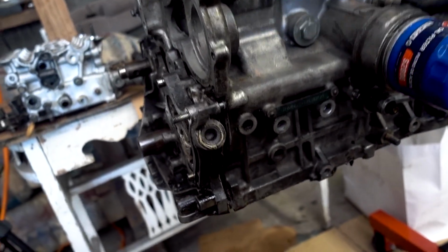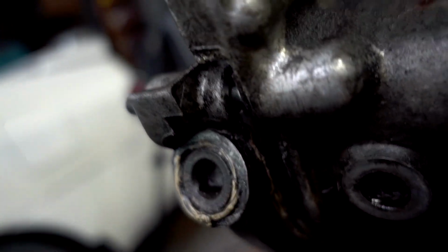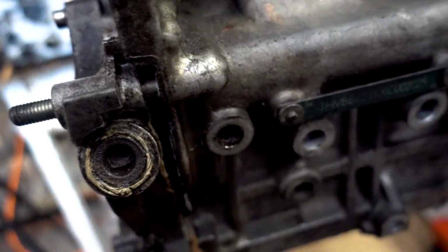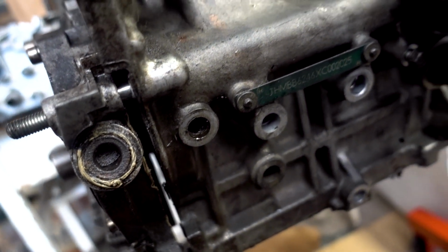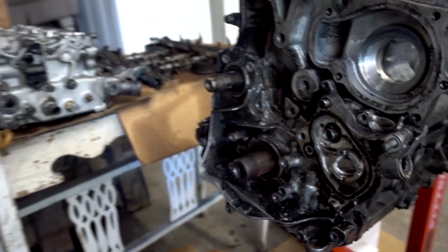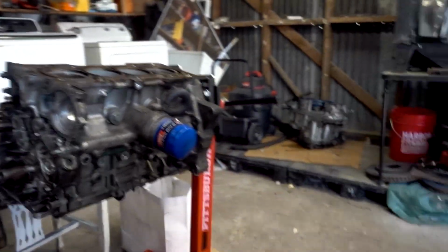And then the cover here, I stuck my pry bar right between here. Well, first, I took my hammer and lightly tapped this corner, and it knocked it off just a little bit, just enough for me to stick the edge of my pry bar in there. Just give that two or three taps. And so it's in, and then I firmly pried on it, and it popped more, which gave me room to pop it down here. And then it broke completely free. So it doesn't take much to rip this out. I'm going to get this cover off, get that rear cover off, and get everything out.